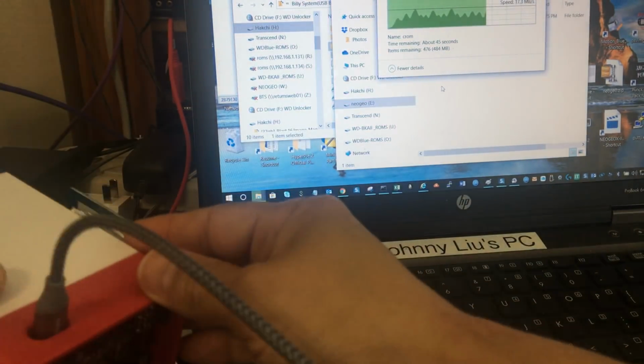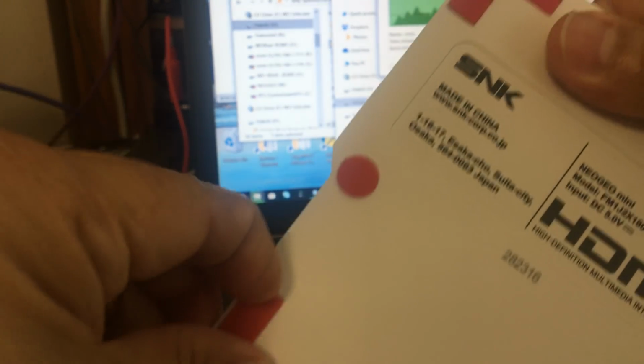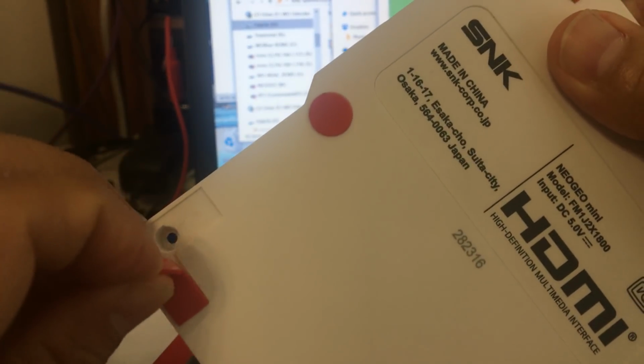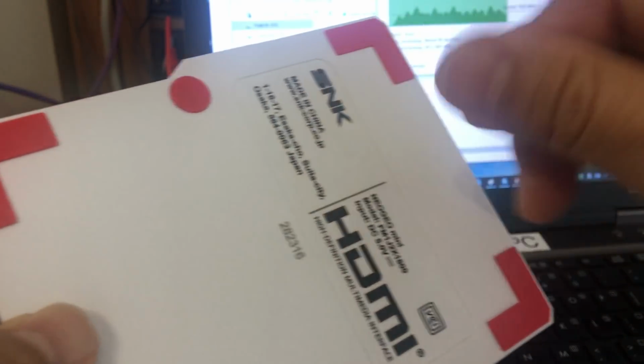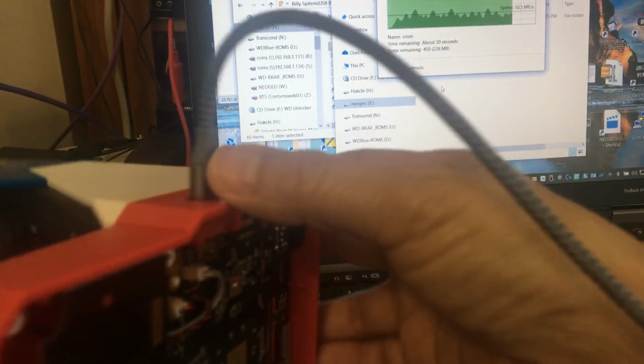So those of you might say, Johnny, how come you did not... if this is your first time and you haven't seen my video, you're going to pop all this out using your nail. Pop it out and then take the 6 screws out. There's a total of 6 screws. 1, 2, 3, 4, 5, 6. Once you take those out, those are Phillips screwdriver, small one. Take those out, and then there you go. It comes out.